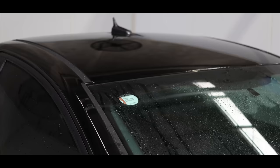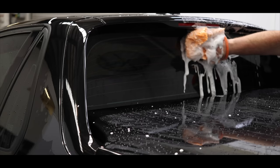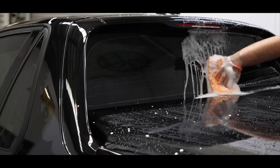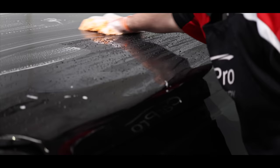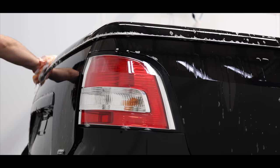With as much surface grime as possible removed in a safe, touchless manner, the next step was using an acid-based detergent to physically hand wash the vehicle. pH iron removers, alkaline and acid detergents all have more unique abilities to tackle various forms of environmental contamination such as fallout, water mineral deposits, grease, baked on dirt and even existing waxes and sealants. The goal here is to strip the car back to bare paint and trims so I have a clean slate once I get to the paint correction process.